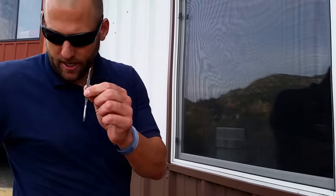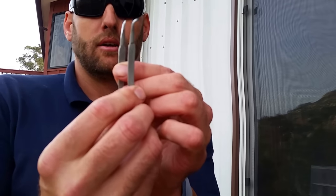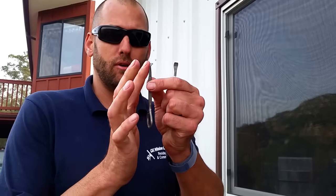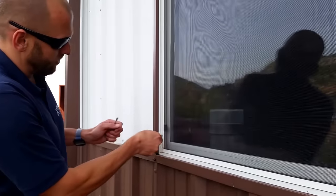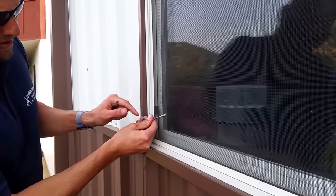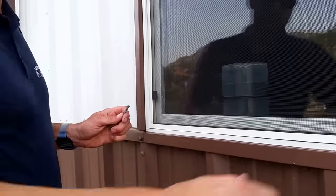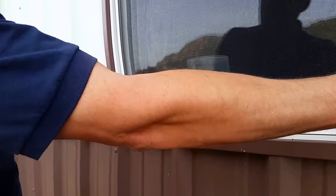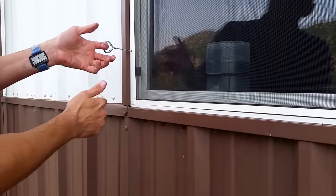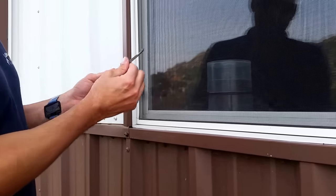On a reminder again, we use this paint can opener as our screen tool. I got a newer one here — you can see how it has a pretty nice edge to it. A lot of guys use either spatulas or screwdrivers, but we use these because they're curved, so you have control. If I'm trying to take this screen out and it pops off, it's going to be rounded so it has less possibility of damaging the screen. It almost eliminates your possibility of even popping off because it has such a nice grip on the back. I grip the back of the screen now, then just pull out. If for some reason it grips off, it just swings back to me — it doesn't release and gouge. I've never gouged a screen with these.